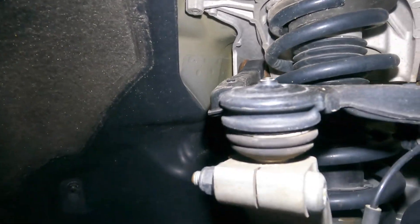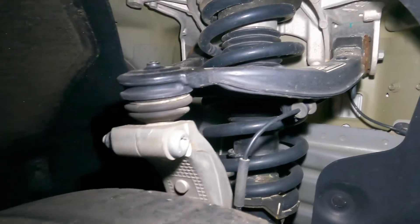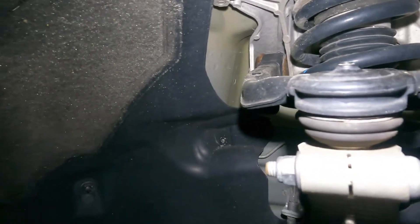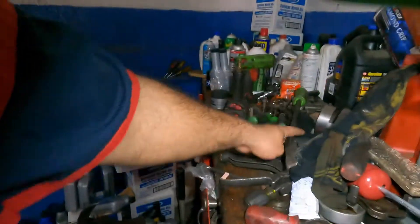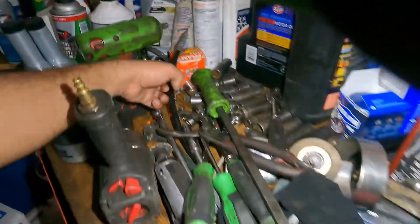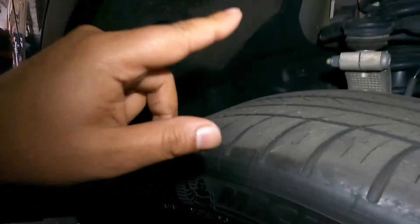It shouldn't be a big deal as long as Tesla can cover it. If not, we'll get a control arm, bring the strut base down — it's got a couple of bolts — the whole strut assembly should come down. For now, I have a grease needle for the grease gun. I'd throw some grease in there in the meantime, but let me do the tires first since I've got tires to do and then we'll come back to that.